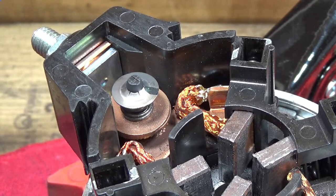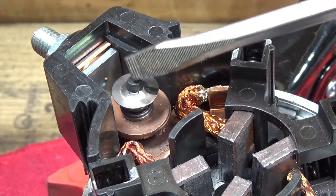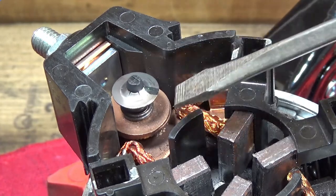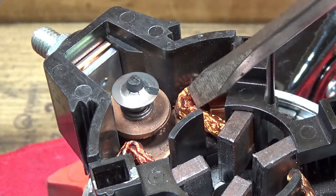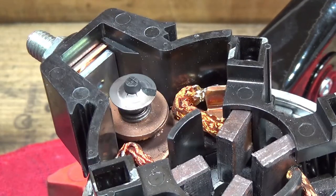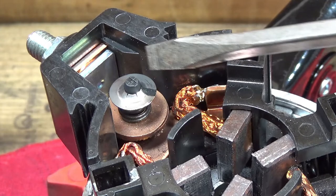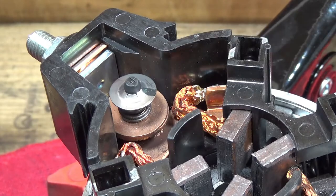Just for fun, I've set it up so you can see how the electrical circuit is activated by the solenoid. When the solenoid turns on it pulls down this plastic shaft. The plastic shaft has this little metal push nut on it, and a spring and a copper washer. That gets pulled down to contact the 12 volt battery contact into the brushes and feed current to the motor. So I'm going to hook up the solenoid to 12 volts just to watch that in action. Just picture that on a cold day — all that stands between your car starting and not is that little metal push nut on that little plastic rod, and whether it stays on there or not. Pretty amazing.